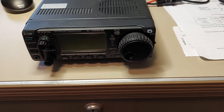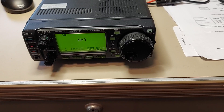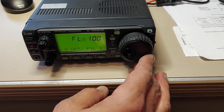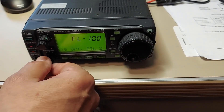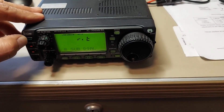All right, moment of truth. So what we have to do now is get into the initial set mode. To do that, we press and hold the lock button and press the power button. Okay, now we're into the initial set mode. To set my filters, we go over to the filter selection. Once we get there, option filter one — and now it says "no." We have the FL223 installed. And we go to option number two — we have the FL100 installed. Now it should store that, so we turn the power off to exit.